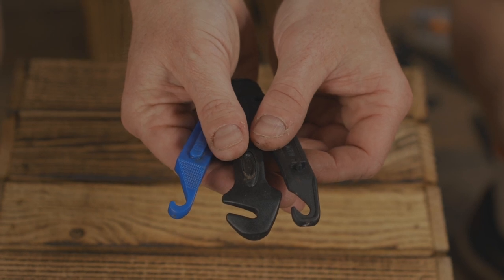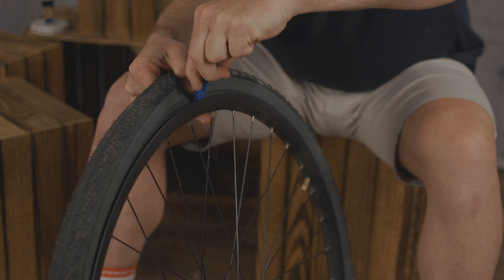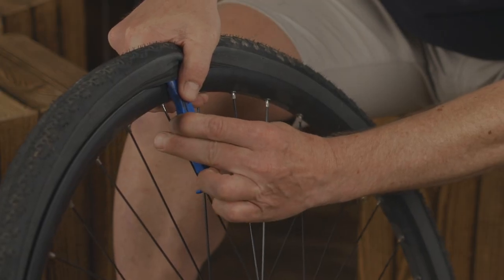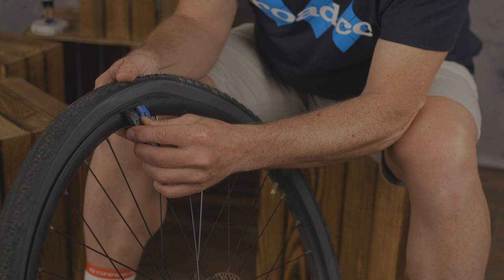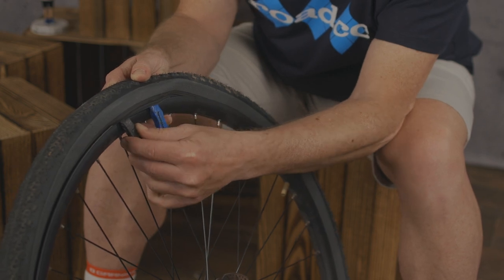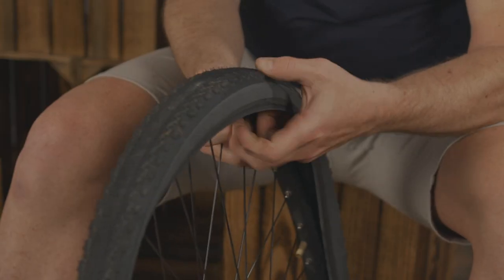You'll notice that most, though not all, tyre levers have a little hook at the other end of the lever to the tongue. This feature is used to allow you to employ multiple tyre levers on the same tyre without running out of hands. The idea is that you work a lever under the bead, cantilever the lever over the edge of the rim lifting the bead, carefully place the hooked end around the nearest spoke and allow the tension to hold it in position. You can now take a second lever and place it under the lifted bead to the side of the first lever and work it a few inches along before repeating the cantilever procedure. With both levers lifting the bead, you should be able to grasp the lifted section of the deflated tyre carcass between the levers with a firm jolting motion and roll it off with your hands.